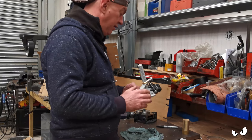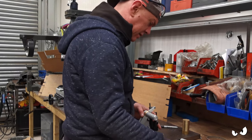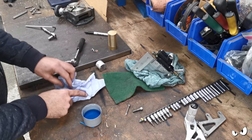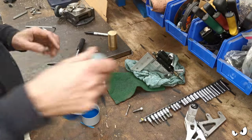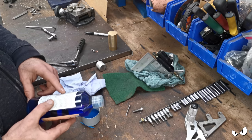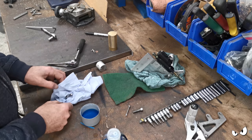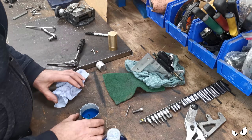That does work lovely. Right, I want to have a go at this cold bluing actually. I want to see what it's like. Right, so he's all cleaned, and I haven't touched him since. We've got some of this goo. One part of blue to two parts of water. Immerse the part. Make sure it's totally covered. I could do that. He's covered.